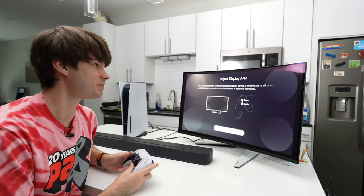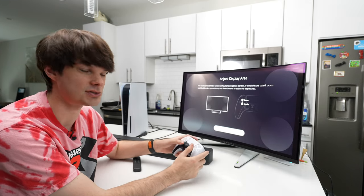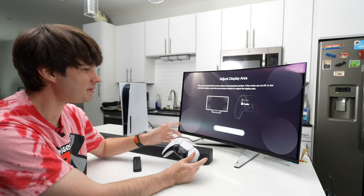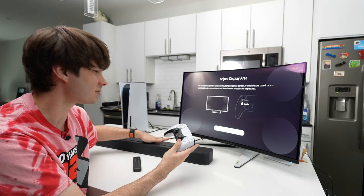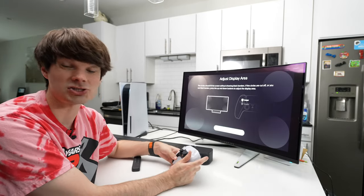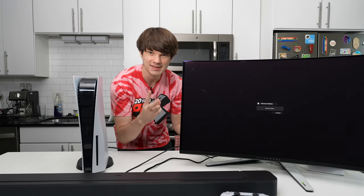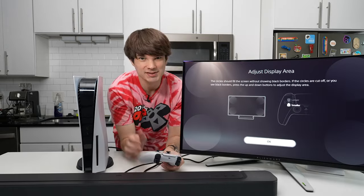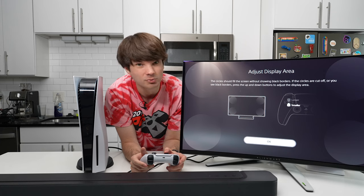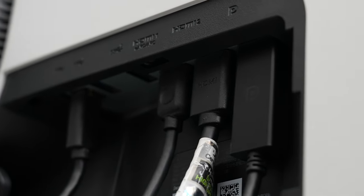Admittedly, in pass-through mode, it isn't the most seamless experience. It's hit or miss whether I get it to turn on. I was able to hit the PS5 PlayStation button to get the screen to turn on, but the dimensions of the screen aren't fitting exactly perfectly. There may be some compatibility issues with HDMI 2.1 in pass-through mode on the soundbar, but there is sound coming through. There is another way to do this that I actually prefer: instead of passing the signal through the soundbar, I take the HDMI from the console and put it in the second HDMI 2.1 port on the back of the monitor. This gives us the picture and also bridges the audio from both HDMI ports, so we still get HDMI 2.1 display and audio — taking up both HDMI 2.1 ports, one for the soundbar and one for the console.